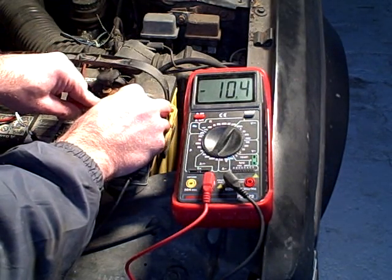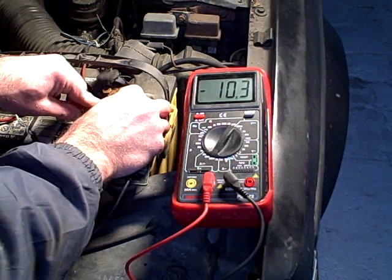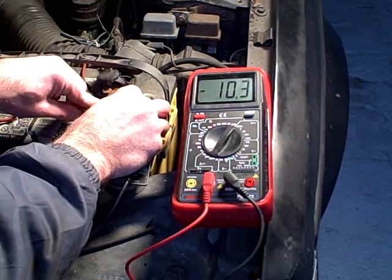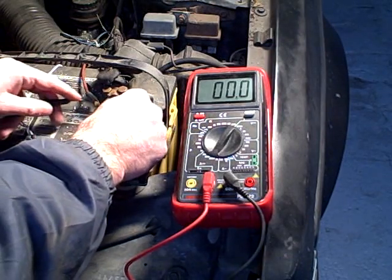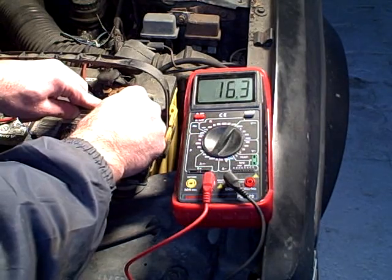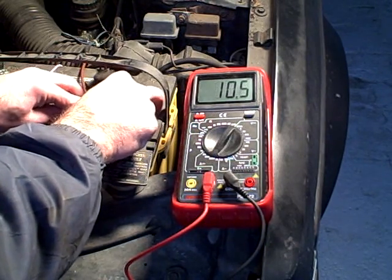And there you see it's 10.4 milliamps, and that's not a lot. I could let the car sit for three months and not worry about it not starting because of drain. I'd just turn around the other way and get the positive sign, or get away from the negative sign on the reading in case you find that annoying.